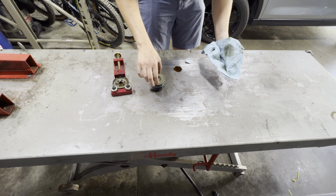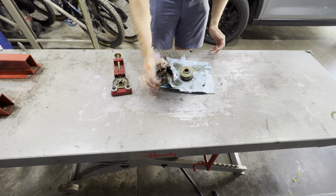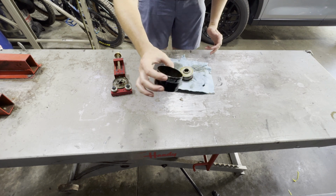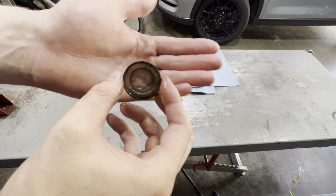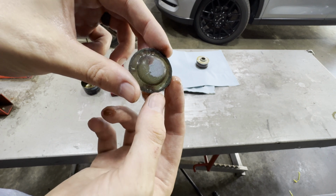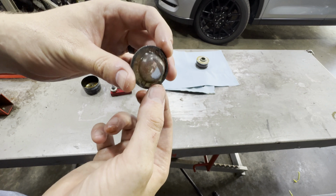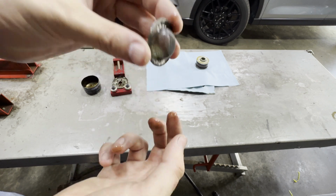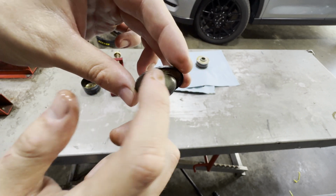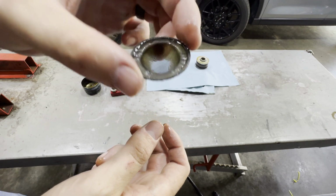And then we have our oil filter cartridge, and then our oil filter can. So this is all junk, nothing in there. It's pretty clean in there. This is a screen for our pressure relief valve internal to our oil filter. When the relief valve opens, this filters that oil, and it is free and clear of any debris. The stuff you see on there is just oil sticking between the screens, but there's no real debris in there.